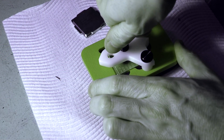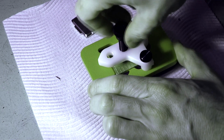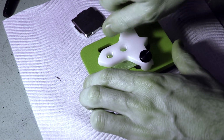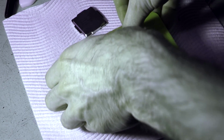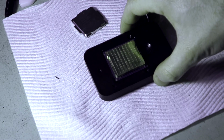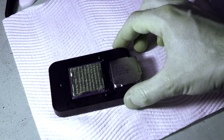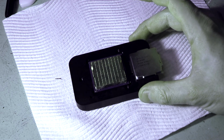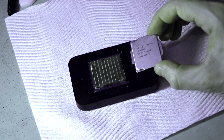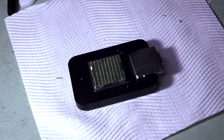Okay, so our glue is now dry. So we remove the main bolt here. Remove the spider. And now we can remove the IHS template as well. And there is our freshly relidded processor. So you can see there the difference in the size between the standard IHS and the aftermarket one, or the copper one. So pretty substantial difference there just in surface area, which is the main contributing factor to the difference in performance. So we'll get it cleaned up, we'll get it reinstalled in the computer, and it is time to see how we went.